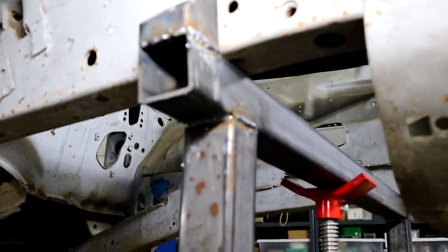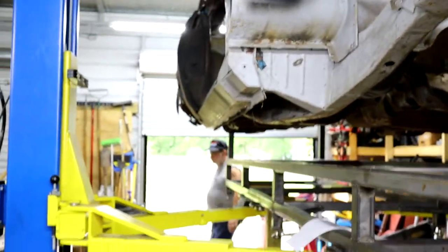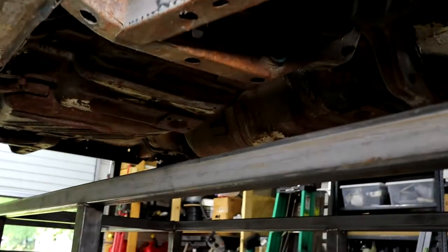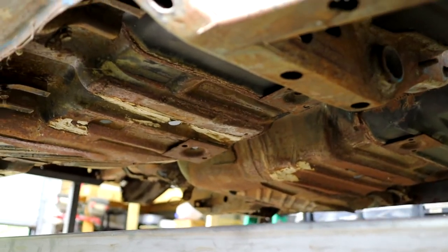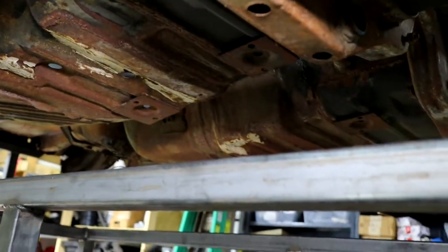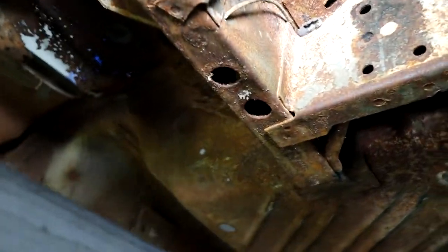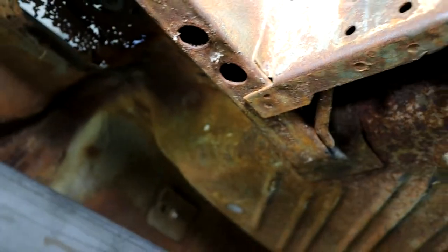We now have the bar in the front completely in place. Notice the angle is a little different because we went ahead and put the car on the lift. We have extra supports now to keep it from bowing too much. We're now working on the midpoint areas. This is the torsion cross member — this is where the torsion bars go through. We're going to run a tube between here and here, and run dowels up into our alignment pegs or alignment holes, and that should help keep things in line. Looking at the back, right underneath the rear wheel well, we're going to run a bar back-to-back here and then down to the jig itself.